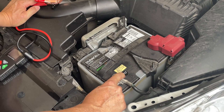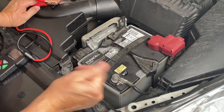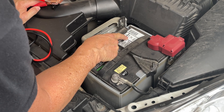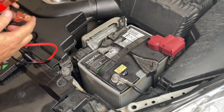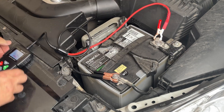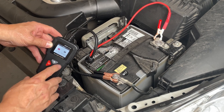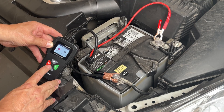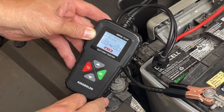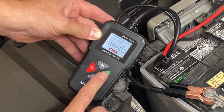Let's try one more car battery and see how it does. This battery is a Duracell Ultra 617, so it's about seven years old now — this is 2024. It shows 640 cold cranking amps, and of course it's a 12-volt car battery. I do like the alligator clips on the tester. It came on instantly — we'll run the test. Let's do a battery test: 12-volt, 640 on the cold cranking amps. Hit OK and it'll start the test.